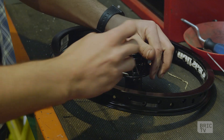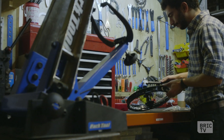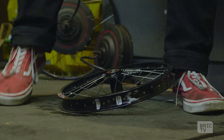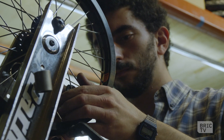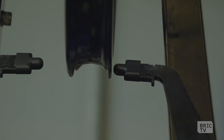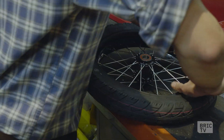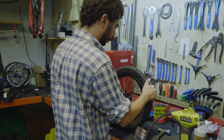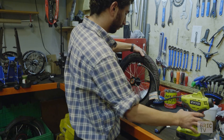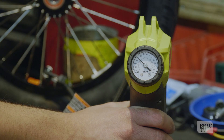On a two-wheel bicycle, most of the loads transmitted to the wheel are in the vertical axis without a lot of side load. Because we're working with three wheels, the rear wheel in particular sees a lot of side load during a turn, so we've had to make sure we're speccing rims, tires, and spokes strong enough to accommodate that. A lot of the development of the trike has centered around operations in New York — one of the biggest challenges really comes down to the rough streets. Everything from the suspension we've developed to our choices of wheels and tires comes down to what's going to be able to hold up.